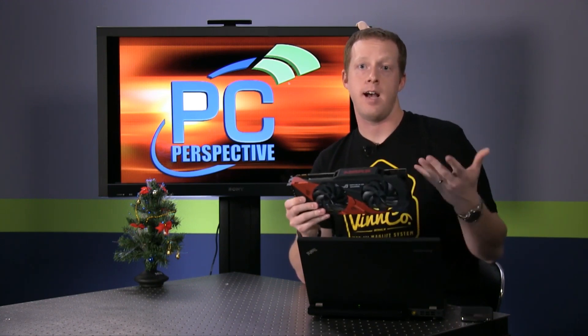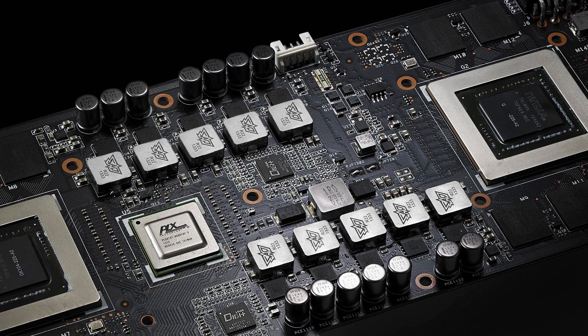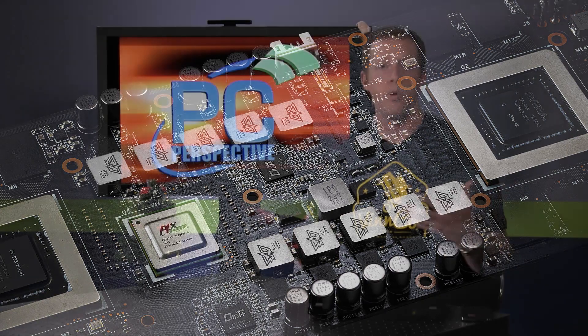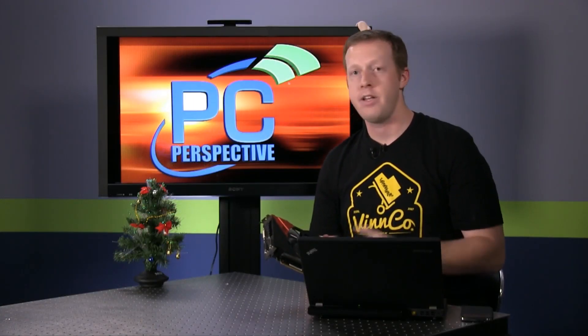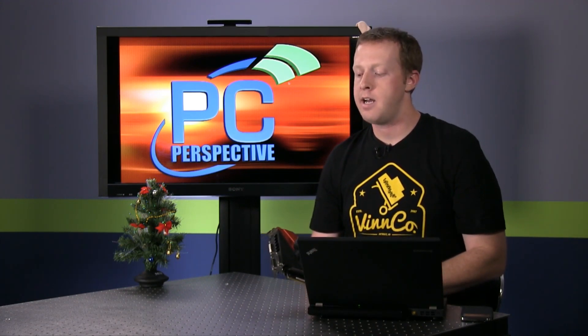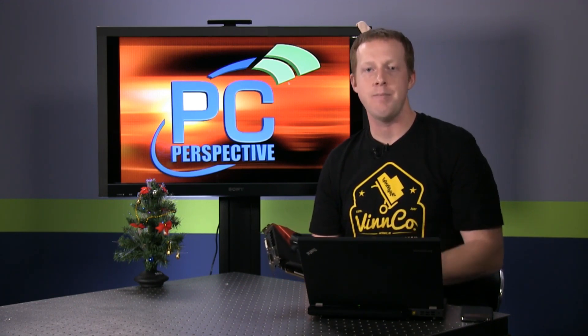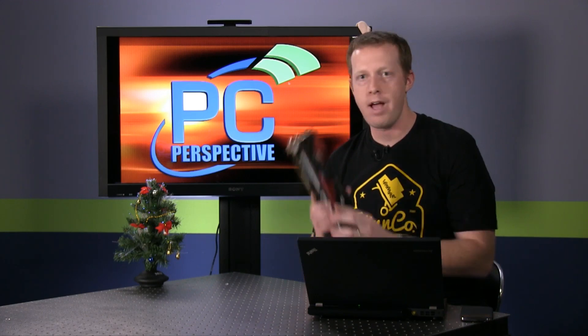The complexity with that is that it's two GPUs, so it has to use SLI to get to that performance level. All those other cards I mentioned are single GPU cards, where it's much easier to get the full performance out of your graphics card. In our benchmarking we showed that in most cases that wasn't really an issue — NVIDIA has been very good with SLI and they don't have those scaling issues with one display or three displays. I'm fairly confident in NVIDIA's capability to maintain multi-GPU scaling going forward.